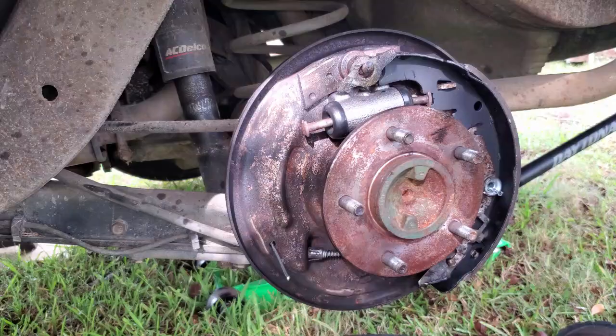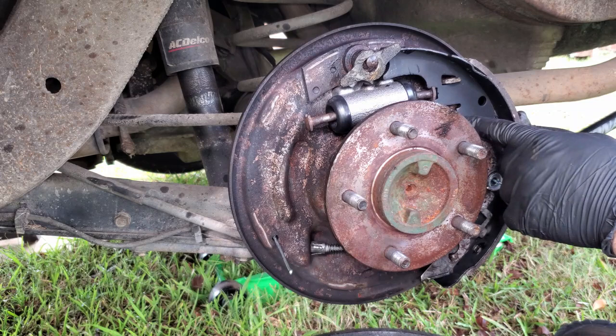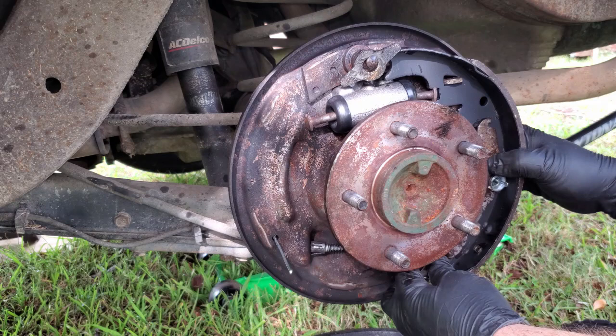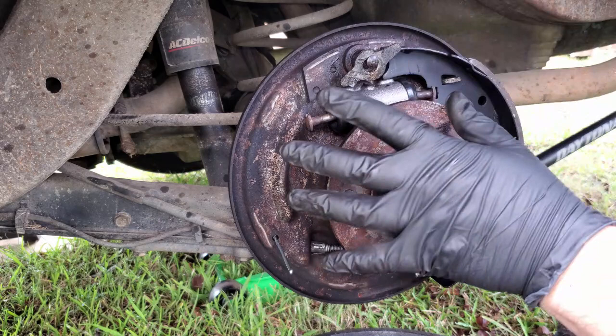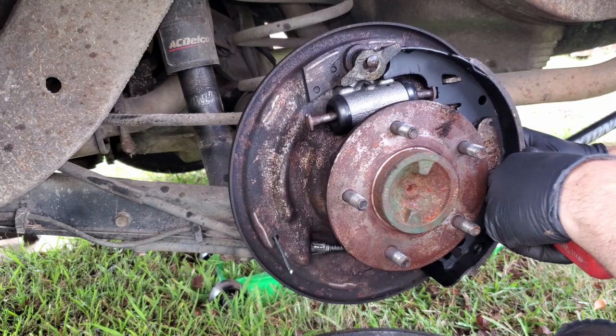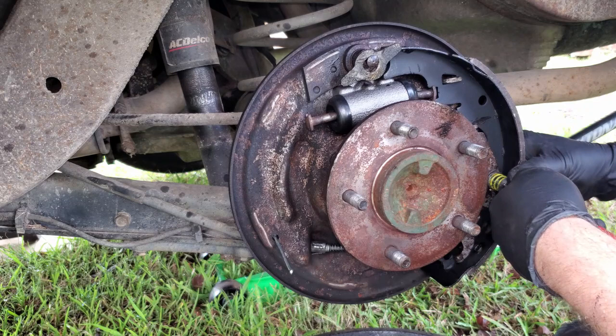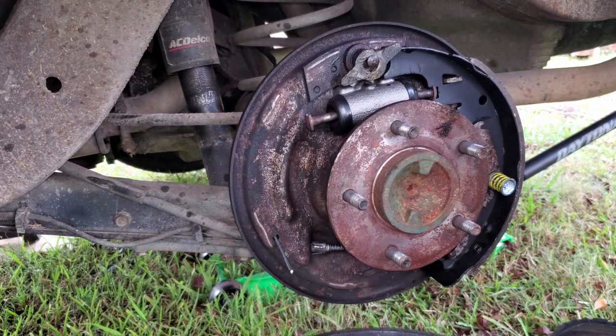We got our new pins in there, got our back brake pad on, our e-brake lever bar is back there, we got our self-adjuster lever on there. Be careful because that does come apart very easily. We're gonna go ahead and throw our spring and our new retainer on there - it'll kind of hold all that into place while we fight the other side. This is where the beauty of this tool really comes in. You just push it through, turn 90 degrees and that locks. Then pick up all your remaining parts and put them all back together by reviewing this video and figuring out how it all went.